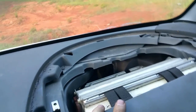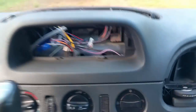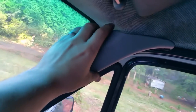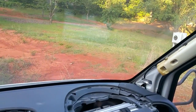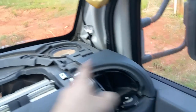We have the airbag area — it looks like it's not in my way because I'm just trying to remove the upper part of the dashboard. I think there may be some hidden bolts underneath here that have possibly already been removed. I'll need to remove the center console. Before doing that, a different trick for the speaker bay piece: I got my fingers over here, used both hands, and slightly pried it out — all the pins came out intact. Then for this speaker piece I'm going to disconnect that bolt, that bolt, this one, and those two.